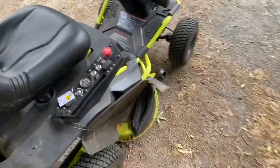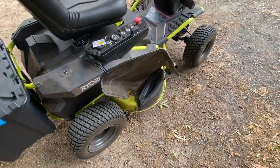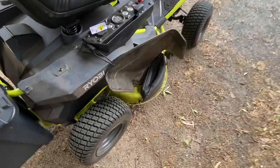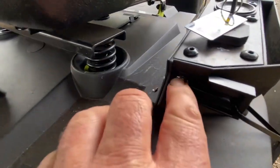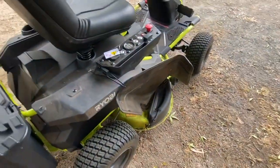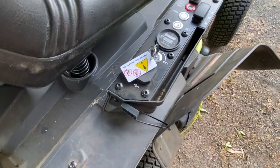The other thing I did: I've got the mulching blades on, and I can't stand the catcher because it sticks out further than it needs to. When you've got a mulching blade on, you really don't need that catcher — it's more hindrance than help. So I found a bit of plastic, unscrewed a screw here and screwed it on, which allowed me to put a zip tie through a little drilled hole in the flap, so now the zip tie holds that flap up out of the way. If I need to use it as a side chute, I can just cut the zip tie off and it'll drop back down.